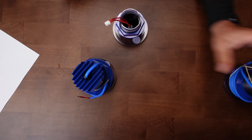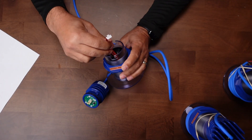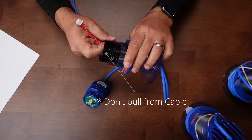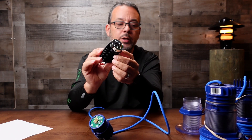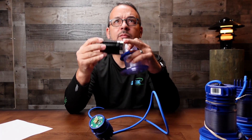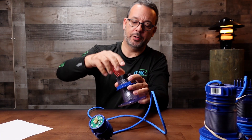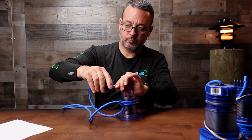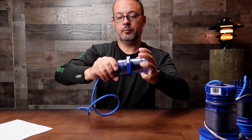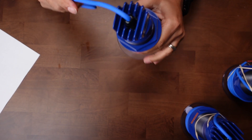While I have it apart, let me show you here. To open it, basically just unscrew it and pop it off. Then you're going to pull the LED board out. Putting it back together is a little bit trickier because you've got to line up these two notches with the two notches inside, or it won't drop far enough. Put it in and just turn it until it drops, then connect the wires and put it in. If you find that you can't lock it in — it's too hard to lock in — then the LED cartridge has not dropped in far enough.